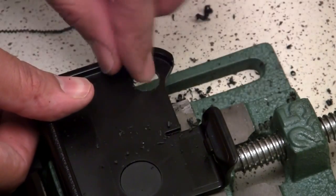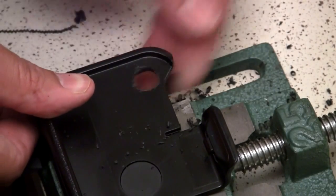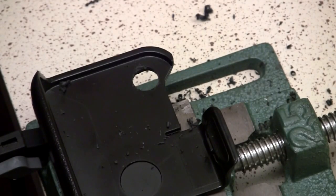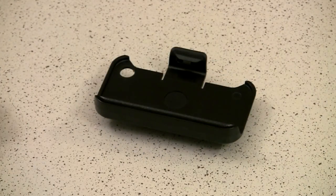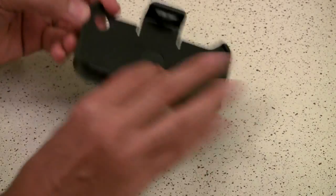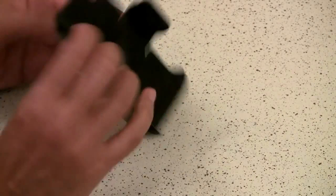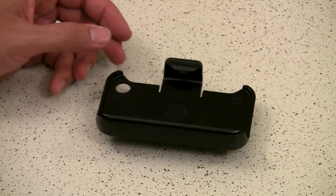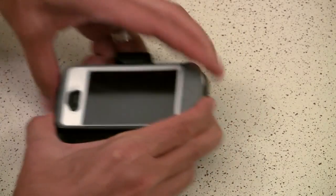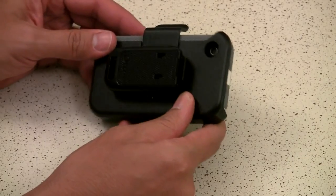I tried to remove as many of the coarse edges as I could with my fingernail, then used very fine grit sandpaper and sanded along the edges of both sides as well as the inside of the hole. Here's what it looks like: the hole looks pretty professional, everything sanded looks like it belongs there. Notice the little neck of plastic between the hole and the top of the case — be aware of that when drilling because it could easily break. When the phone is in place and turned around, the camera can see through the hole and it looks like it rolled off the assembly line this way.